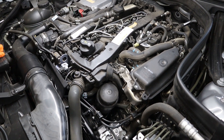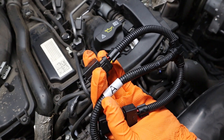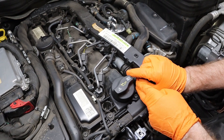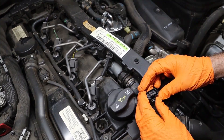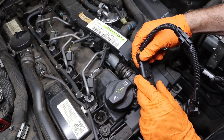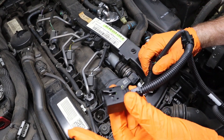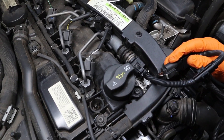On this application, our A connection is going to go to our fuel pressure sensor, and our B connection goes on the driver side of the motor. We'll begin with the A connection going to our common rail pressure sensor. First, pull back on the gray locking tab until it clicks, then push down on the locking tab and gently pull back the sensor plug. Grab the female end of the supplied race chip wiring harness and plug it directly in, going to the same locking pin side. Click it in until it locks and place the gray locking tab. Then take the male end of the race chip harness and plug that directly back onto the OEM sensor, making sure it clicks and locks.